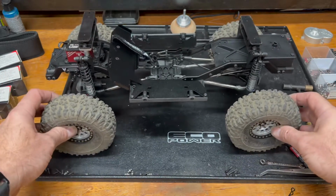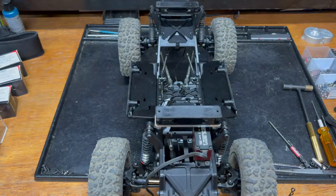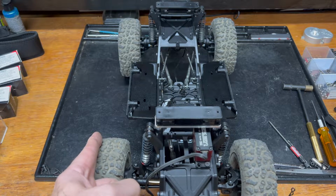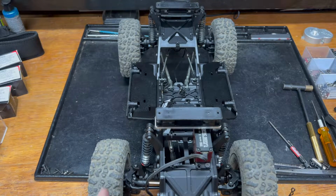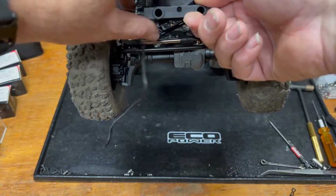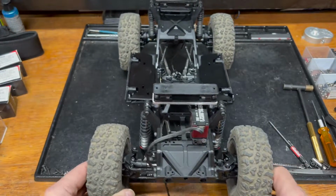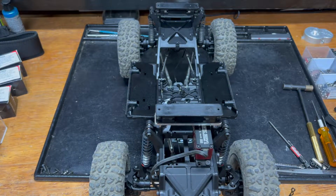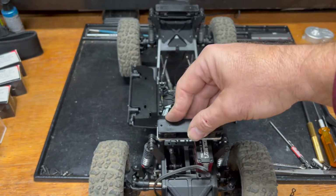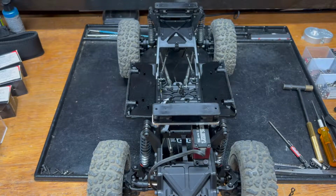We're gonna have to shorten that up. Front looks good, but when you look fore to aft, we've definitely got more tire on this side than this side, which means the panhard is too long. Gonna have to pull that in. I've got some space on that rod to pull it in a little more to shift this over. I mean, it looked fine with no tires on it. Then you get tires on it, and it's quite a bit over. I'd say maybe 10 millimeters to that side. Yeah, the bump steer looks noticeable, which is indicative of that panhard link being too long.